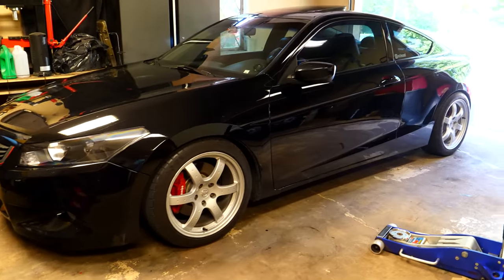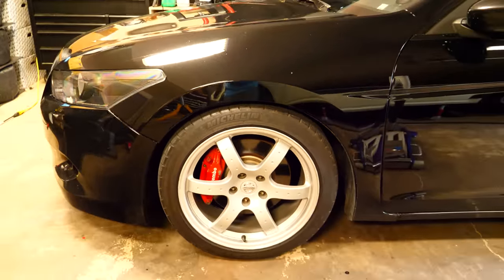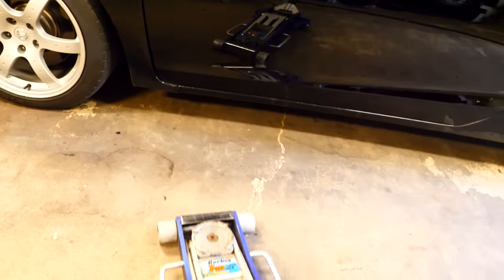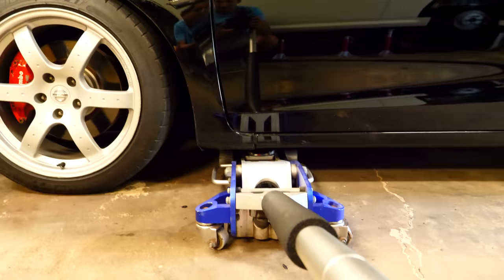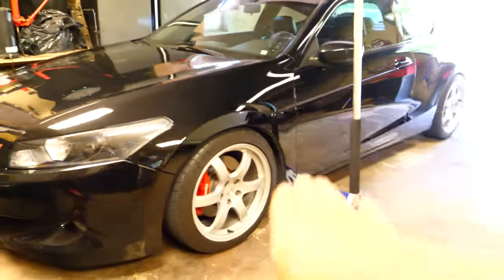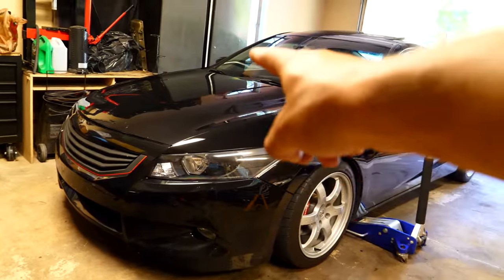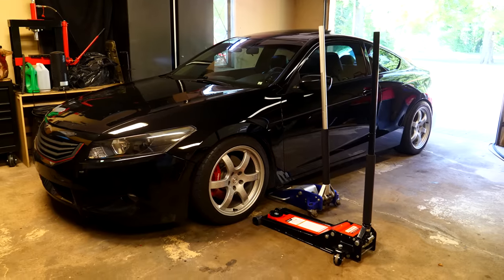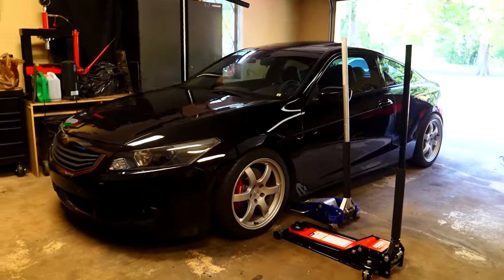Looking at my Accord, you'll notice it's a little bit lower than stock — I'm on adjustable coilovers and there's still a small tire gap, which is completely normal for this setup. It's low but not super low. When I bring the jack underneath the car, it barely just ever so slightly clears the bottom part of the pinch weld, which is where you'd install it. The problem is that when you raise up one side, the other side gets lower, so you can raise one side fine but then you can't fit the jack underneath the other side. With the new jack I'll be able to solve that problem completely. And if you have more than one jack, you can put one on each end and jack the car straight up without having to lift one side then the other.